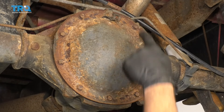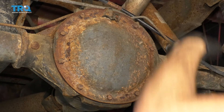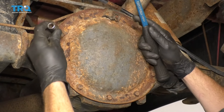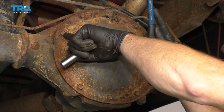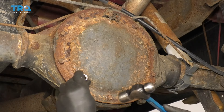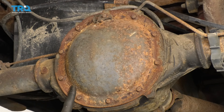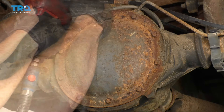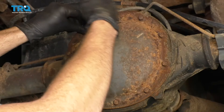Make sure you keep in mind where the bracket's gonna go — right in the center — because it needs to go back there once we take this all apart. Use your 13-millimeter socket and a nice light hammer, or a rubber mallet if you're worried about it. Just go over these bolts and tap them to break free all the rust, rot, or any obstacle that's going to make an issue getting these bolts out. Make sure you have a nice collection bucket because after you remove these bolts, there's gonna be fluid behind here that needs to go somewhere and needs to be recycled. Now let's start that bolt back in a little bit and continue by removing all the rest of the bolts.